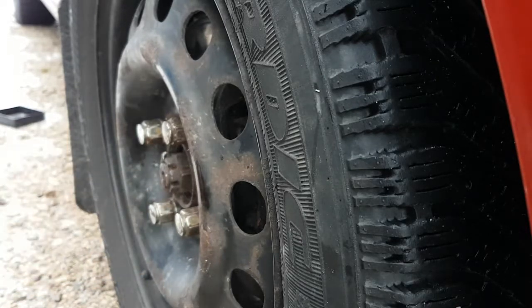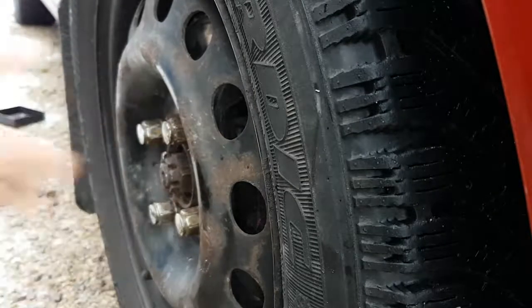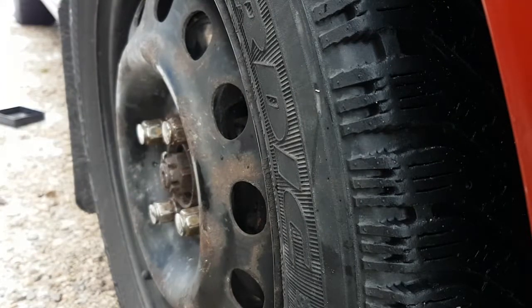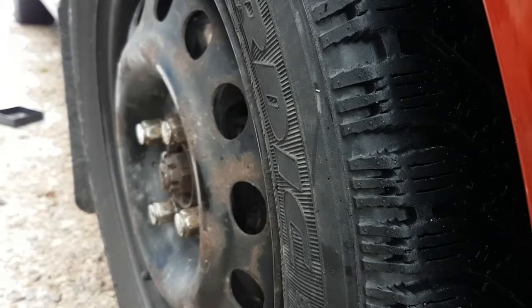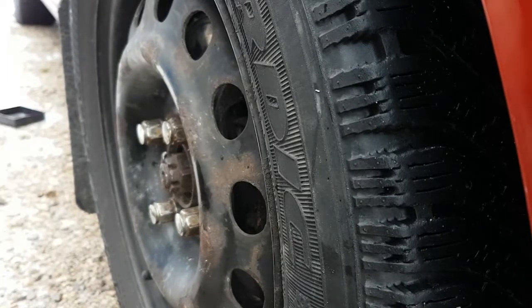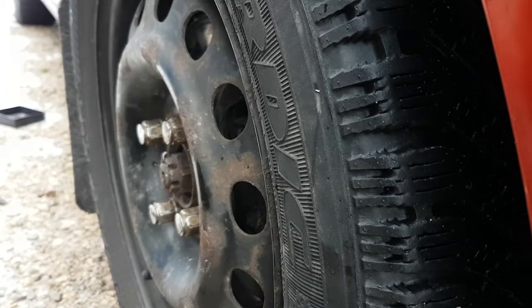Some of them are cartridge style, where it's just like 3 or 4 bolts hold the whole hub and everything in the spindle. You pop the bolts out and hammer it out and put the whole new one in. You don't have to do any of that pressing or anything. Usually they're more expensive than this style, but if you ever come across having to do this style, I think all the tools cost me $270 for all the stuff off Amazon. That's the slide hammer and the bearing presser tool, and then the bearing splitter was another $160. So for like $350, $400, you save yourself a whole bunch of money. That's like one wheel bearing change at the shop, and just labor's like $300 or $400 easy. So you buy the tools, you do it yourself once, and now you have the tools. It only costs you the wheel bearing next time and the time to do it.